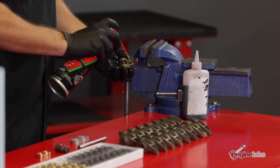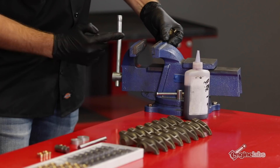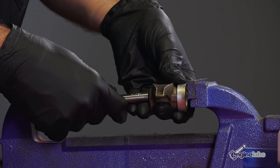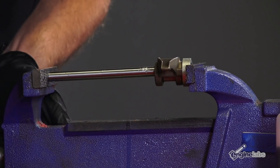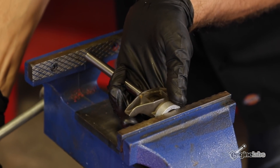First, we need to make sure we clean and dry the rocker arm so we don't make an oily mess all over the place. Once they're clean, place a rocker arm into the vise and use the tools on both sides, holding them in place while you snug the vise. Double check and make sure everything's lined up and the tools are pushing solely on the trunnion and not making contact with the body of the rocker arm. Slowly tighten the vise and watch the factory needle bearing move until it pops out.